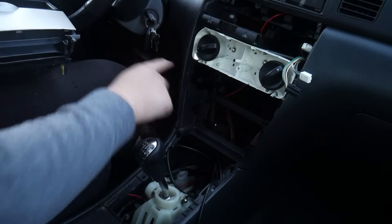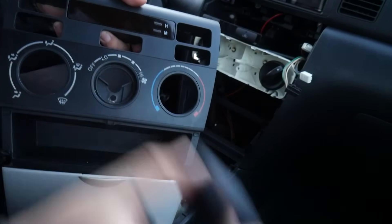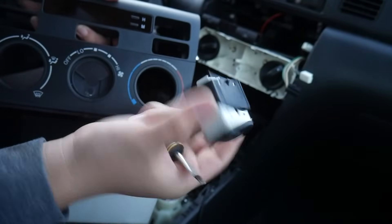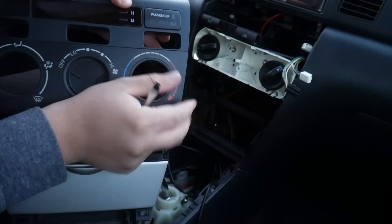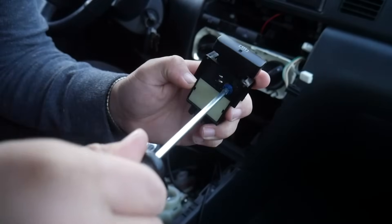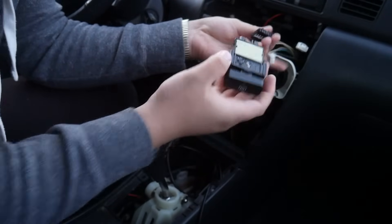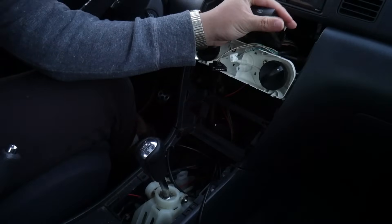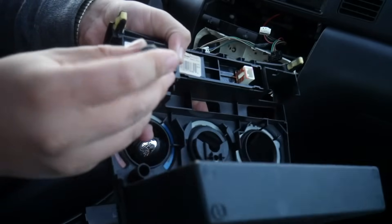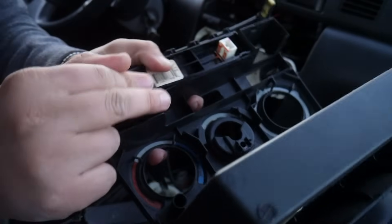We're not fully done yet — on the panel you still have the emergency lights and the rear window defroster, both of which light up. The passenger airbag light has no replaceable bulbs, so pop that back into place. On the rear window defroster, there's one bulb — it looks like a Phillips head. Pop it out, replace it with a new bulb, plug it back in, and it lights up. To remove this button to begin with, take a screwdriver right here, pry it a little, and it'll pop out — it just clips into the little square. When you're done, just press it back into place.